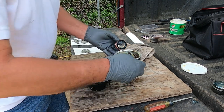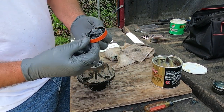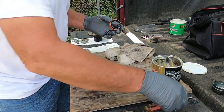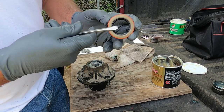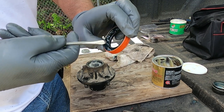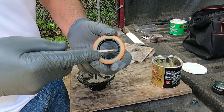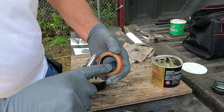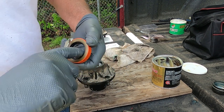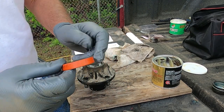I want to take my seals, either the ones that come out of them. You can see it's still got grease inside. That ain't gonna hurt them. Main thing you want to worry about on the seals, it's got a rubber part right here. Then it's got a spring on the inside that wraps all the way around it like a rubber band. Make sure all that's still good. All that's good and smooth. No breaks, or dried out, or cut or nothing. All that's good.